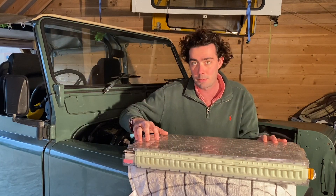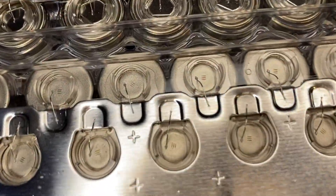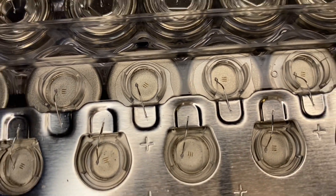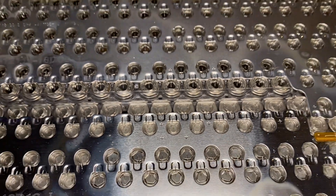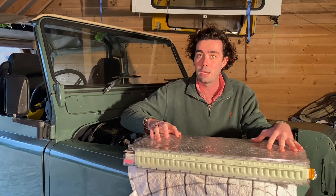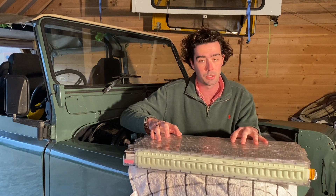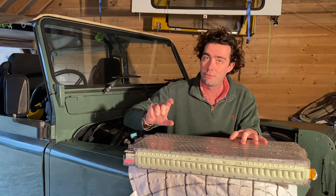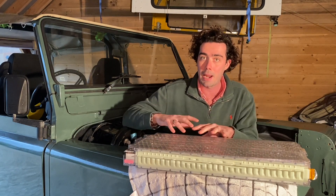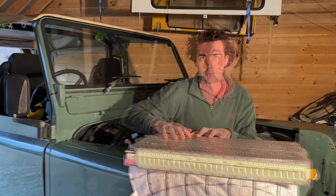This battery has 444 individual Panasonic cells. A Panasonic cell is slightly bigger than your household double-A battery. The 444 cells in here are configured in a 74p 6s configuration, meaning 74 cells are wired together in parallel, six times.